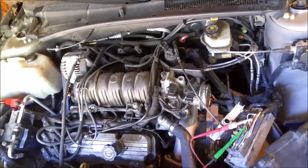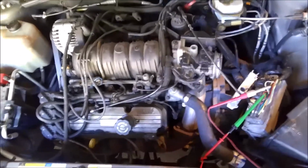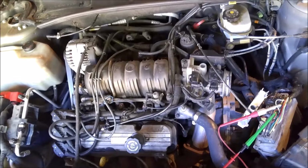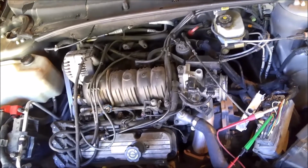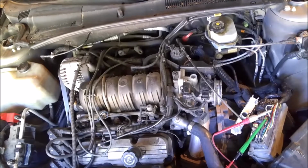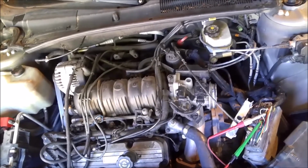So I thought, okay, it needs a crank signal. It's 20 years old. It's got over 200,000 miles on it. It's never had a crankshaft sensor put in it. So I went ahead and threw a crankshaft sensor in it, and the car ran great. Drove it for about 45 minutes, shut it off and on several times, never cut out, ran perfect. Came out throughout the day, started right up, didn't do it, ran perfect. I thought, great, it's fixed.